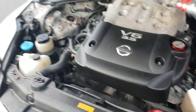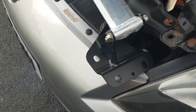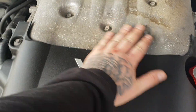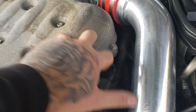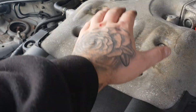It looks a little bit weird without the strut brace — really weird. I want to get the new one and give you guys a peek. As you can see, it's a lot thicker than the old one — a hell of a lot thicker. This should be a direct fit. There are a few clips up here you have to undo — they literally just push straight through. One thing I have to be careful of is the spacing, making sure there's enough clearance not to scratch anything. Eventually I'm going to fit a plenum spacer, which sits between the block and the top — that lifts things up slightly, allows air to circulate easier through the induction kit, gives a bit more power, and gets all the cylinders firing equally. So I'm just going to reverse this process now.